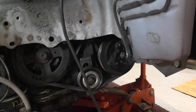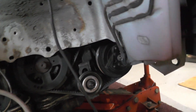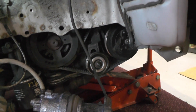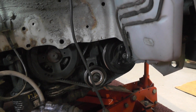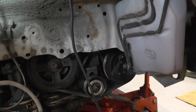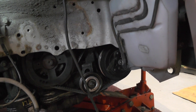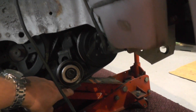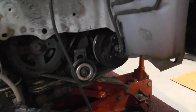Anyway, they're done now. The moral of the story is: don't trust it when you go to auto supplies for your spares, because one belt fitted okay, but this other belt — according to the part number it was right — but the belt wouldn't even look at it. So I had to go back down to my supplier, and he measured my original belt and said it's 40mm longer — nearly 2 inches in old money. He went and scoured his warehouse and brought me one that was about 30mm longer than the original, and it just managed to fit. I've had to put the jockey pulley right back to its minimum setting to get it on, but it's on now.